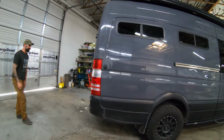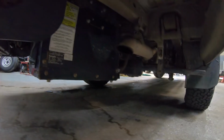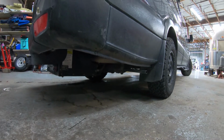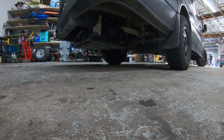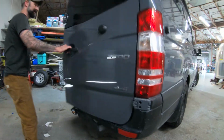you'll notice that off the back, lower end back here, we've got an inboard generator. This guy produces 30 amps, so you can run an AC and some outlets on the interior. It does sit a little bit lower, so that's just a precaution. Make sure that you're not dragging over giant rocks and stuff like this. It's gotten banged up a couple times, but it still runs nice.